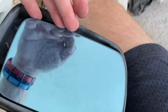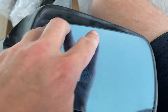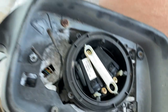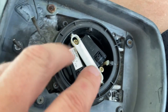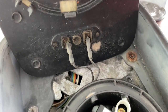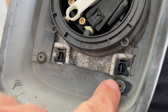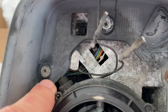I found some YouTube videos that show you can just pry this off. Since I didn't worry about breaking this one, I literally just pushed it out of the way, grabbed it, pulled it and popped it off with my hand. There are four little clips here that clip into here around the ring on the motor. My attempt is to take this motor and move it over to the new mirror because the motor in that one does not work. When you get the glass off, there are going to be these two little contacts right here — you literally just pull them off. This is for the heated element that's in there.